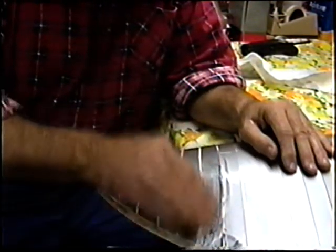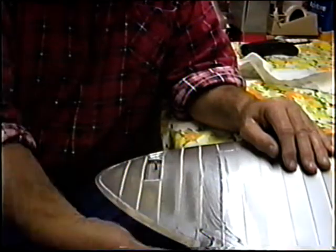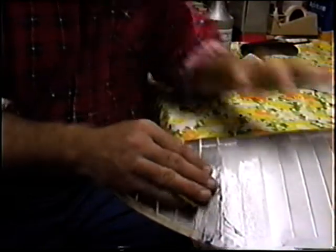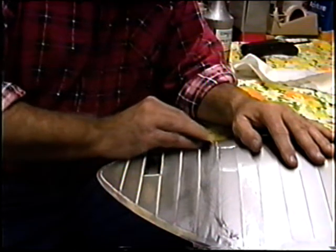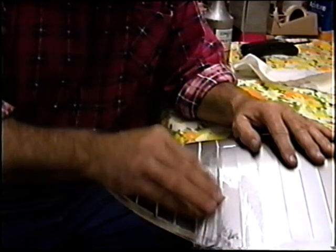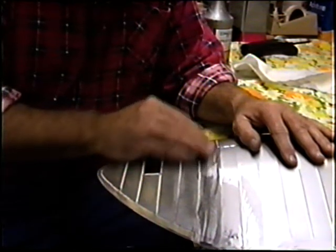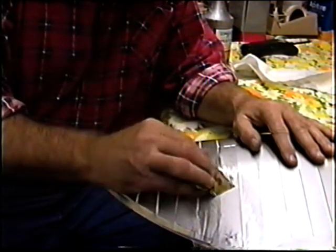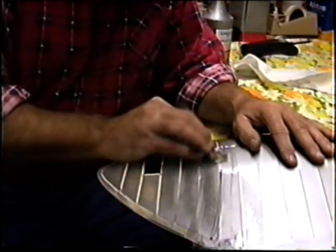Anyway, when you go to clean this bay out, and I know this is one of the problems people have written me about, you've got to keep it floating, good and liquidy, if you want to make good progress with 1200 paper. But the biggest thing is when I get to the end of the sand out on this bay, I don't want to leave the material that's dripped around the wing on the other side of the wing. That's a real problem. I remember several people working in a shop, especially outside in the sun, where it cakes up and makes for a real problem.